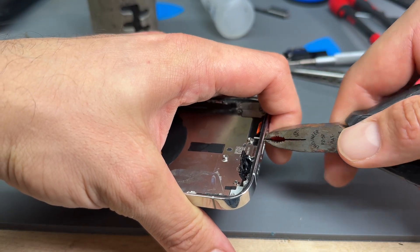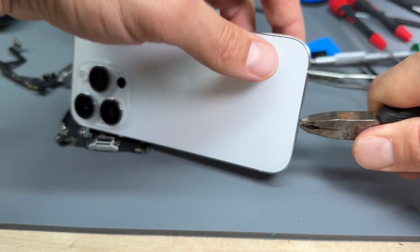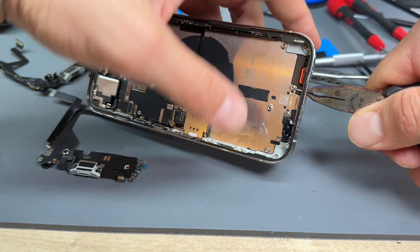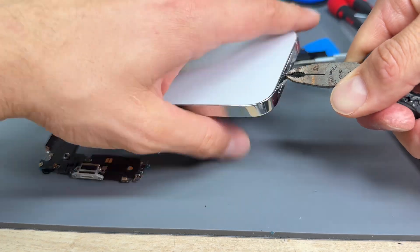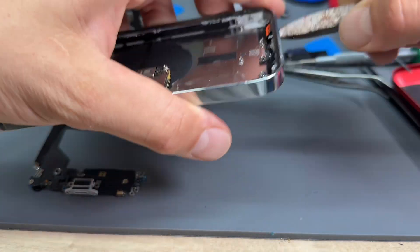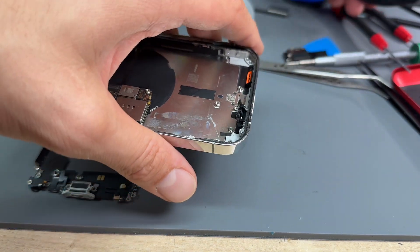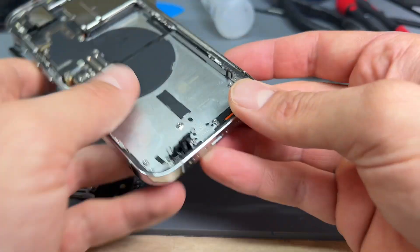Twist it side to side until eventually you can get it from the other side — you can see it poking out and how rusty it is. These pliers have a shape that lets you grip the end of the screw and spin it out. Be careful not to scratch the bottom edge of the phone. Once it's out, just make sure you've removed the charge port first — you won't get it moving without doing that. Thanks for watching.